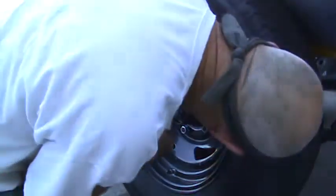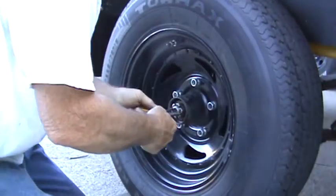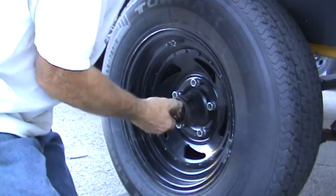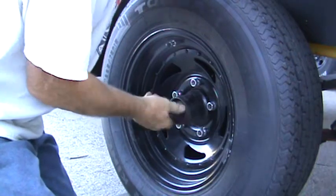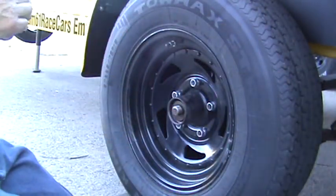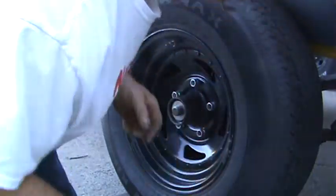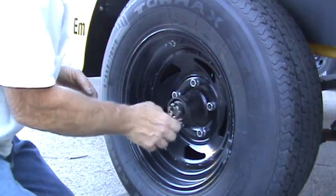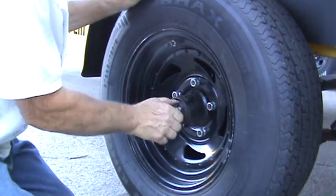If I turn this down to the next one, then it's too tight. So I'm going to back this completely off and try 25 thousandths on this one — see what that does. What it allows you to do is get just the right preload on the bearing where it's not too tight and not too loose, and you can still match up with your locking pin hole.